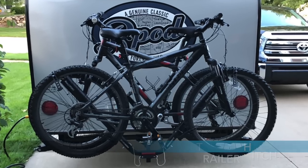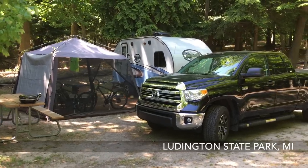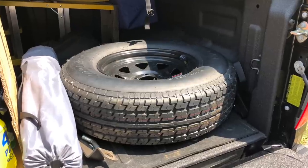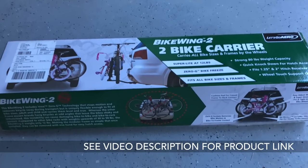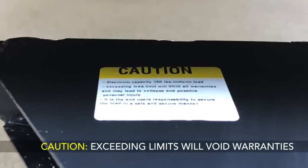Finally, at the very back of the trailer is the trailer hitch — and that's what we ended up going with. This adds just minimal incremental weight versus the spare tire. On my 2017 R-Pod 179, I have a big 15-inch spare tire. The bikes are easy to access since they're just right on the back of the trailer. The negatives are the bikes are pretty visible and you have to relocate your spare. We went with a Let's Go Aero Bike Wing 2, which works really well with the smaller hitch on the R-Pod, well within the 150-pound capacity listed on the hitch sticker.